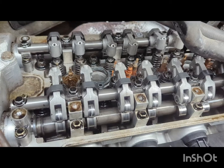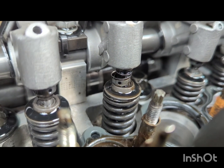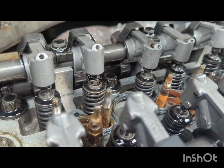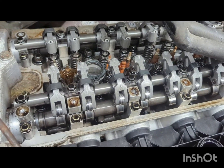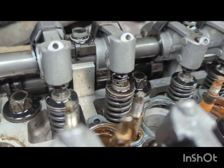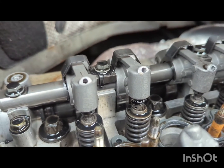Having a look at this valve train here, straight away I can see what looks to be a dropped tappet there, and that could have been the cause of the problem. I need to get in a bit further and see what's going on — see if there are any other ones that look like they're out of place, or if it's just that one. That's a good sign to find something loose straight away on the top end.